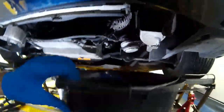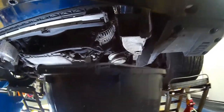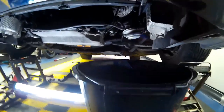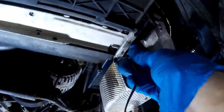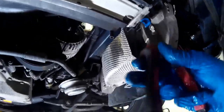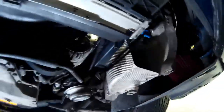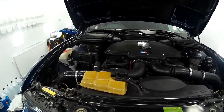Once the coolant system has finished draining — because the vehicle's on a rising gradient facing forward it's not going to clear all the coolant out, so it's got majority of it, about eight litres in the bucket. Once that's happened put the bung back in into the bottom radiator, give it a turn to make sure it's sealed, then fill it with distilled water and start the engine and run it until it's warmed up, then drain again.